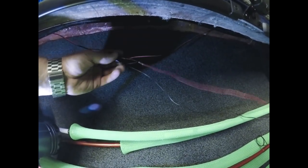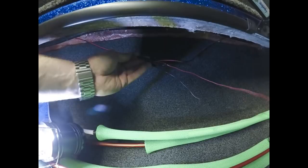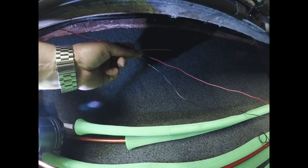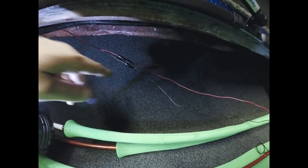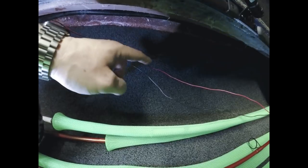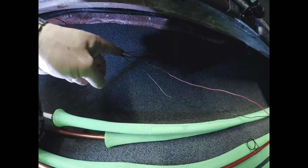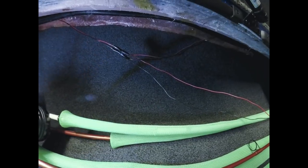the correct butt connectors. Obviously, you're going to want to connect red to red. So, for example, on this butt connector, I have the red wire coming from the 20-inch strip. Out the other end is the red wire of the 12-inch strip, and the red wire that's going to take us to the next LED. Even though we're dealing with 18 gauge wire, if you take the LED wires and the extra wire that you have to cut to size and twist them together, you can still get them in the 18 gauge butt connector and crimp it down nice and tight. They're heat shrink butt connectors, as I mentioned.